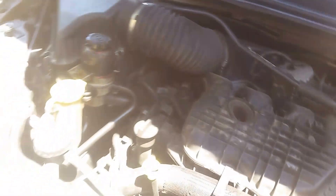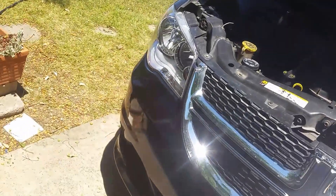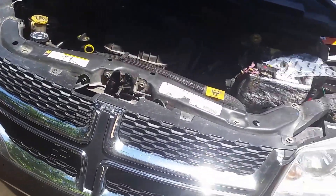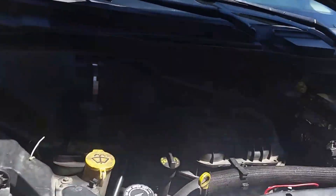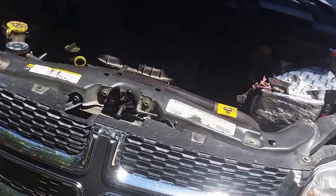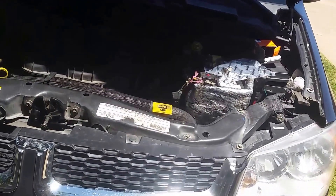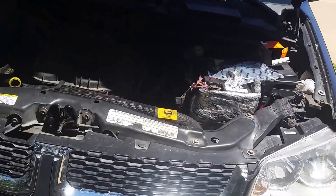Let me give a little backstory. Every year I have issues with overheating and I've always been upset with Dodge. The thermostat they put on there is unreliable and opens too late. I've purchased at least 10 of them and they all open at different temperatures — anywhere from 204 to 212 degrees. That's too hot. I don't want to burn up my motor. I've got 315,000 miles and I take good care of this vehicle, so I got a low-temp 180 degree thermostat.